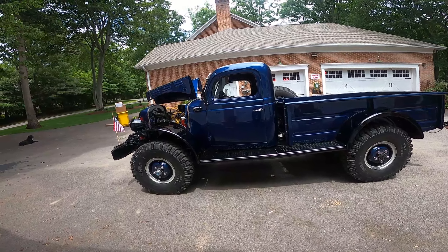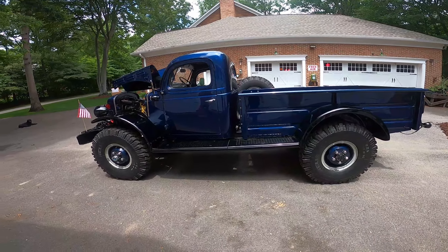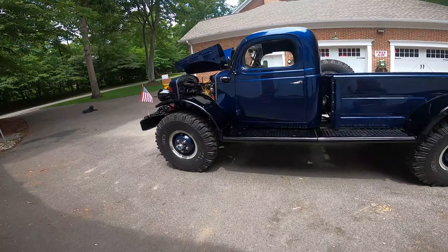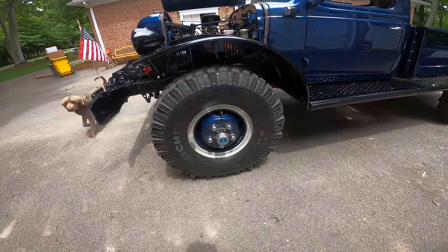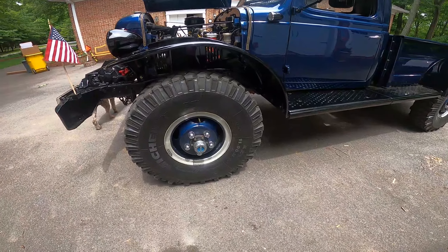The market for this truck was actually farmers — it could be your truck to work in the field, and your truck to go pick up straw, fertilizer, whatever you had to do in town. This truck is relatively stock. The out-of-the-box gearing on this is 5.83 to 1, which means the realistic top speed is close to 35 miles an hour.